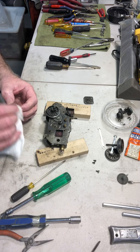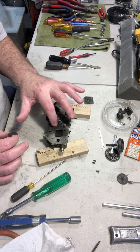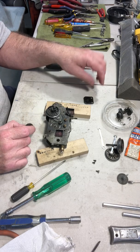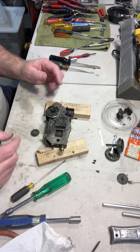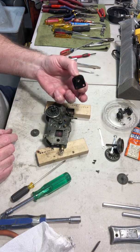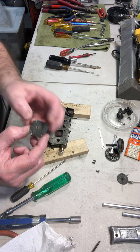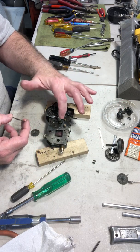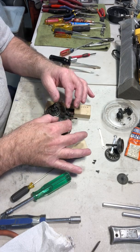So it could be a combination of a couple things that I may not be able to fix. If the pin is worn a little short, if the gear is rubbing because the plate is tight. I've actually taken some of these apart, and I saw guys who put them on backwards, and that gives a little bit of life back to a plate because it's not worn on that side. But as you can see, they're not exactly the same on both sides. This bushing in there is in pretty good shape. Sometimes these get worn out, they get egg-shaped, and then that causes the armature to kind of roll funny. I don't know if this would actually do any good to do it this way.